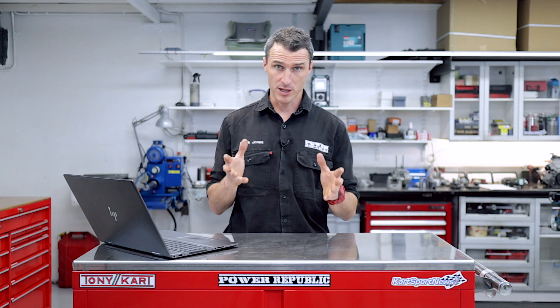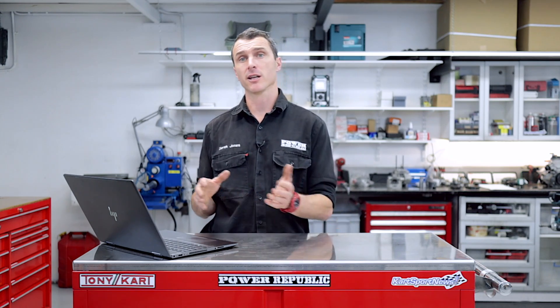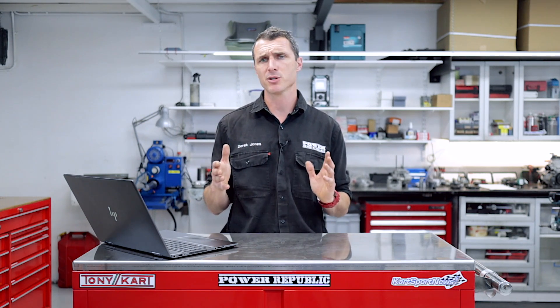Another great tool — though it is budget sensitive — is the tyre temperature sensor kit. This kit can monitor your tyre temperatures live as you're driving around the track, collate all that data, and relay it back to your Micron head unit, which you can then download to your computer. This is a great tool for chassis tuning, getting the optimum out of your front tyres and the working-side back left tyre if you've got predominantly right-handers. You can see with your axle and camber changes what effect it's having on the surface temperature of your tyres.